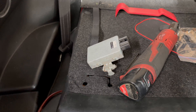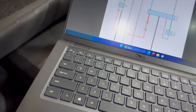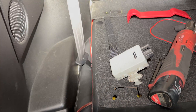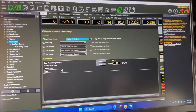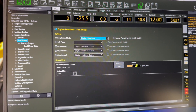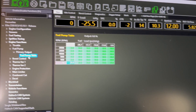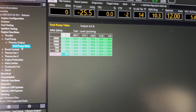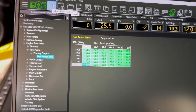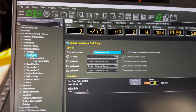This is the fuel pump control ECU — it puts out variable voltage to the fuel pump to control its speed. Most people delete these but I want to keep it. I tried lots of things to get it to work. The FPC pin should be expecting a signal which is wired into the Haltech, but nothing I did got it to power on. I got some helpful input from a Facebook group — at least one person understood why I'd want to retain this feature. I needed to set it to 100 Hz, and my problem was using 100% duty cycle. When you send 100% duty cycle, it doesn't run the pump — the max is 70%, and at 70% that's actually its lowest state; 30% runs the pump at full tilt. Now it's working. If I reboot the ECU the pump runs, which is awesome — I'm glad to retain that since I'm going to be running a return fuel system.